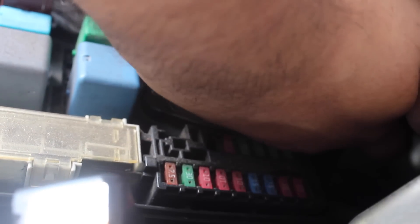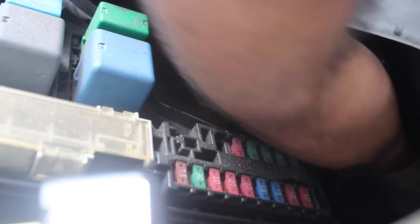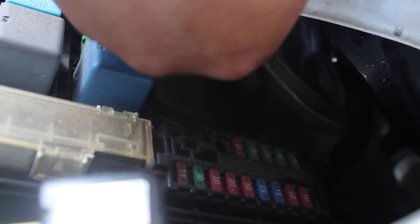Here I'm showing you where exactly you're going to be working. That's the spot behind the bulb and that's the little rubber seal — right there where my hand is. If you have humongous monkey hands like me, this is not a job for you. I removed the fuse box cover first because that can get in the way. There's a little knob you have to grab onto and turn it counter-clockwise about 5 degrees — that's all it opens — and then gently pull it out. Don't yank because the bulb is in there.